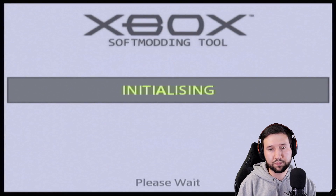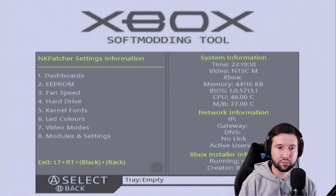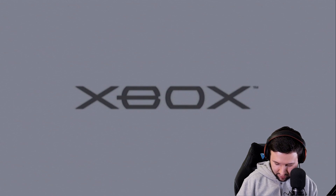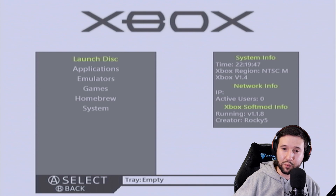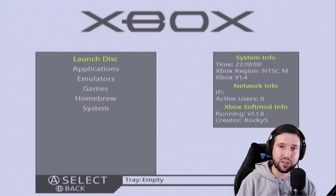The master password will be set to 'team assembly' — just hit okay and let it do its thing. Once it's all set, exit using left trigger, right trigger, black, and back. The very last thing we have to do is copy our EEPROM information to our PC to make sure if those files ever get lost, we have a way of bringing them back to the Xbox so they're not permanently gone. Let's get back to the PC and wrap up.